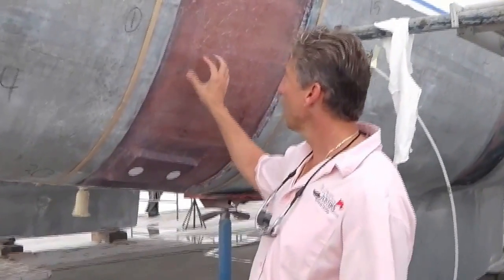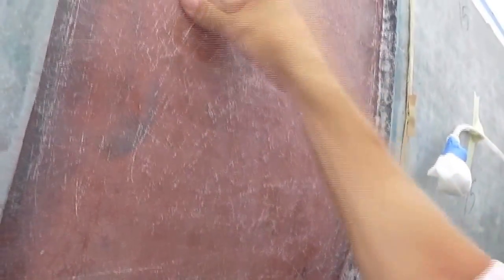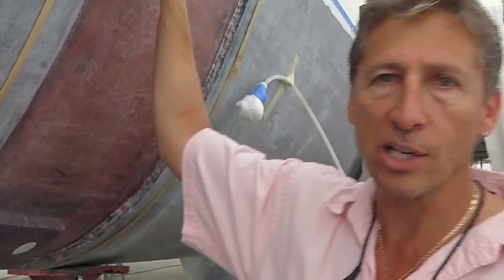We're doing all the floor replacing on the bottom. If you can follow me over here, I've got one two-ounce mat on here. That's a pretty unstable skin for an inner skin. So what we've got to do is harden this up and make it stable before we vacuum the core to it.